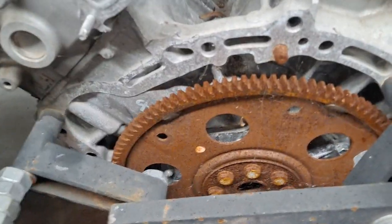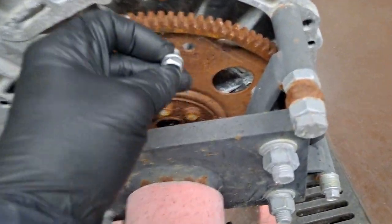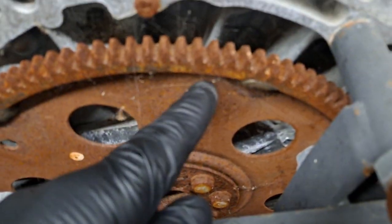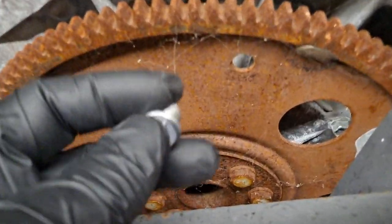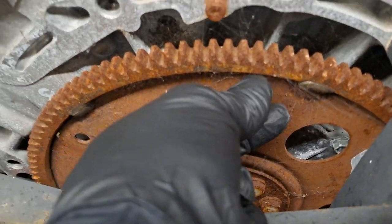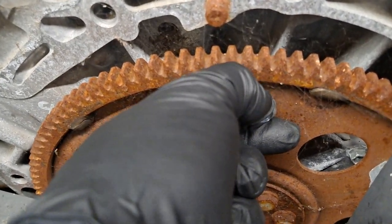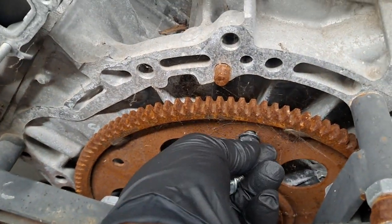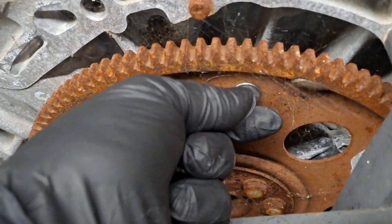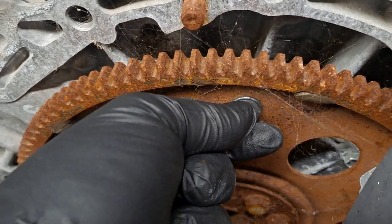All right, so I don't exactly have the engine and transaxle to show you, but if you look at this, these are gonna be the holes. Those bolts are gonna come through this direction normally, but I can still show you the concept. This bolt going through that hole, there's a lot of looseness there. But check out the black bolt. If you get it in all the way, it's tight. The black bolt's much tighter. There's just a little tiny bit of movement.